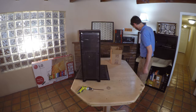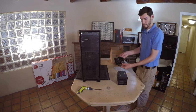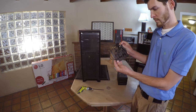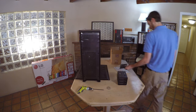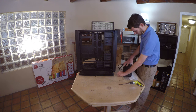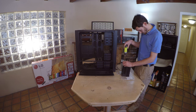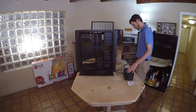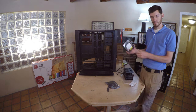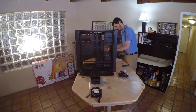Now you can prepare the backplane for the actual hard drive chassis. Use a Phillips screwdriver and install 4 screws to secure the backplane to the hard drive caddy. Prepare your hard drive, remove it from the static bag, and then install it in the toolless hard drive caddy. Repeat the same process for each tray for each section of the computer's case.